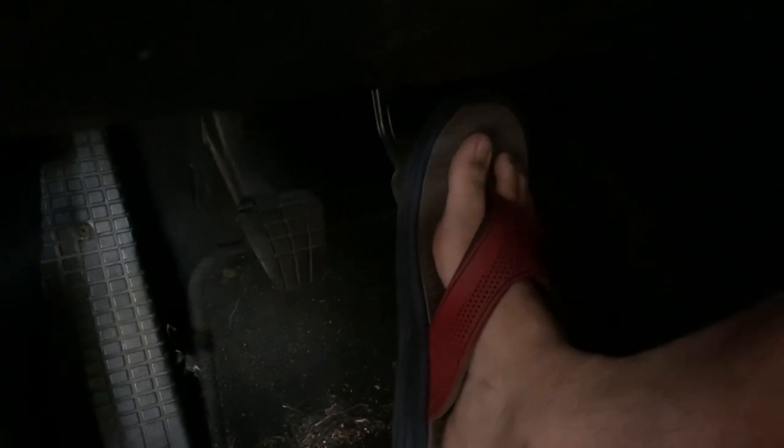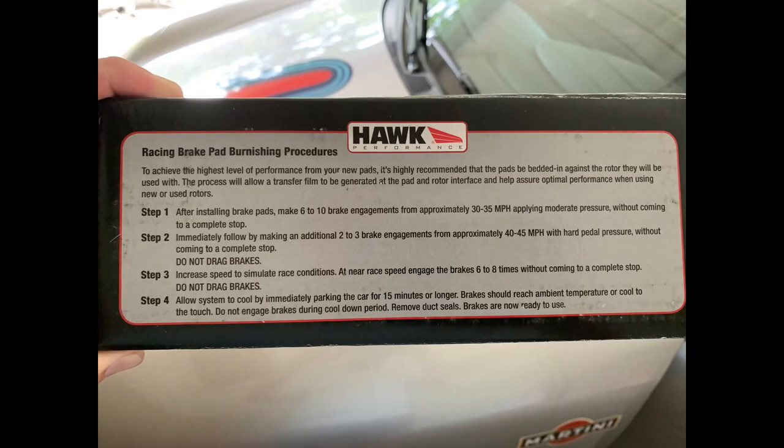Here's the important reminder: pump the brakes. Watch this - all four wheels have had the brake pistons compressed, so the pedal goes to the floor. Already it's pumped back up, but whenever you start to drive make absolutely sure you've got good brakes before taking off. All four corners are done: rotors done, pads done. We still have to do the braided lines and fluid replacement - saving that for the next video, with a link at the end. For now we need to eat barbecue, take a shower, and then take a quick test drive. I'll pop up the break-in instructions from the box right here - pause if you want.